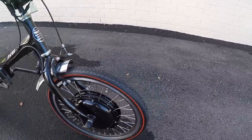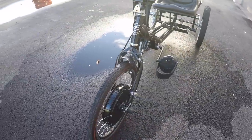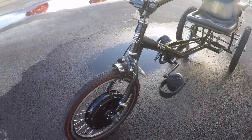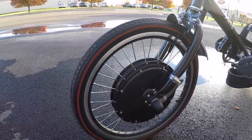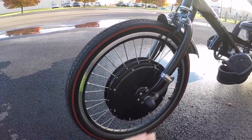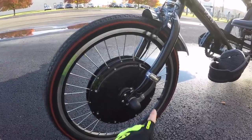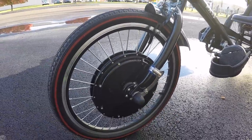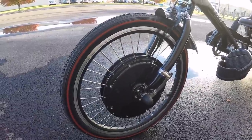It has a 500-watt motor with peak output of 1,000 watts. This thing is intense and really smooth. It doesn't have gears inside — it's just a bunch of magnets around the edge. It's quiet and comes on with a nice sloping power curve. They've still got a big torque arm so it won't damage the dropouts.